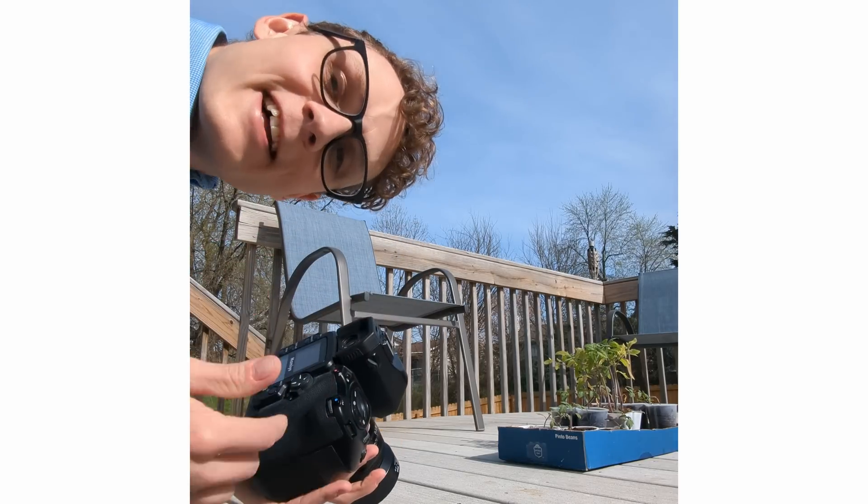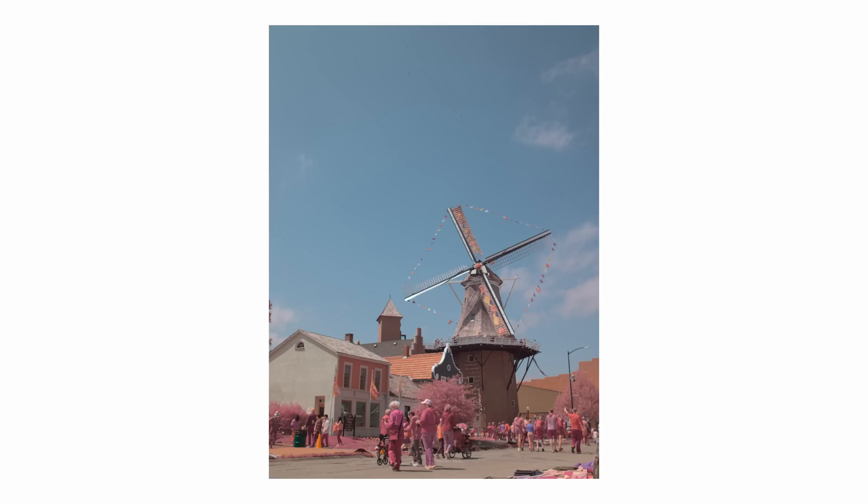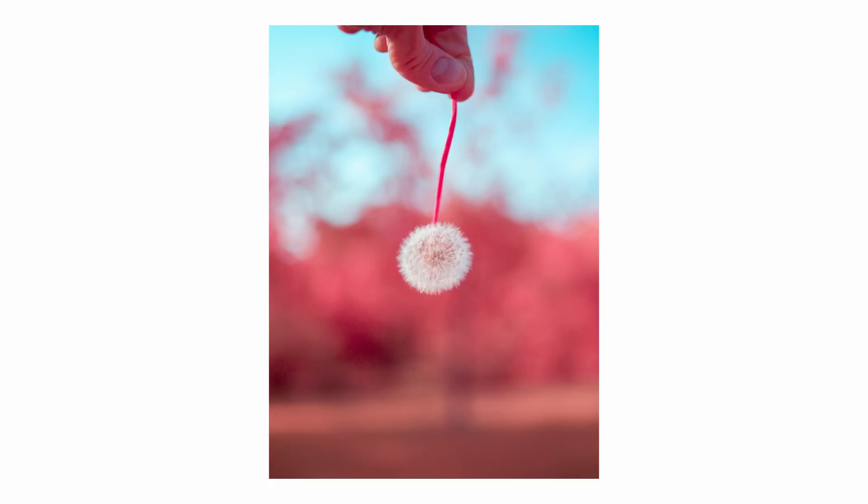Now that I have the filter out and the cartridge intact, I'm super excited because I think this is going to work. I still don't know how the camera will react to having a dummy cartridge — will it let me take a picture? And are there more IR filters on the sensor itself that I don't know about? One final touch to mark the cartridge apart from my other one, and let's take this outside and test it. Shot — and we got purple images! It's working! This totally works and I'm stoked.